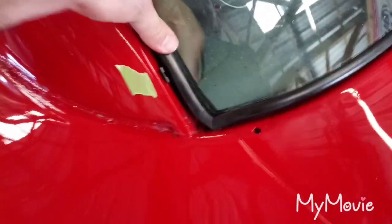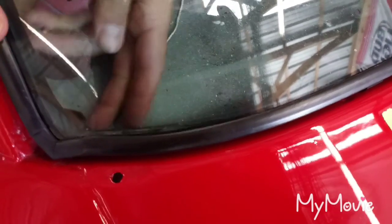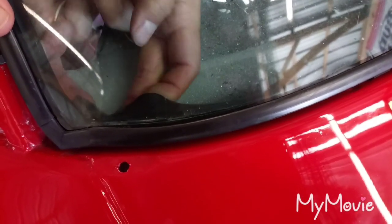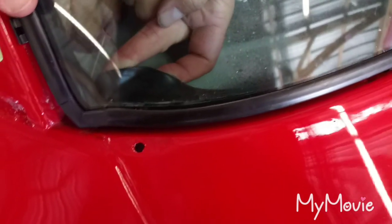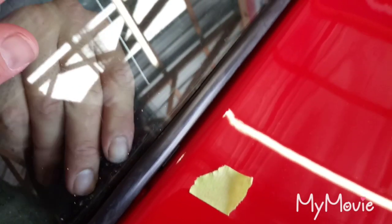We made it around the corner. That corner's tricky — you just pull the string and it'll come out but you've got to pull it hard. That's really what seats the window. There you go — you got it. Now you want to pull straight up. Doing good. We're about halfway done on this back window.